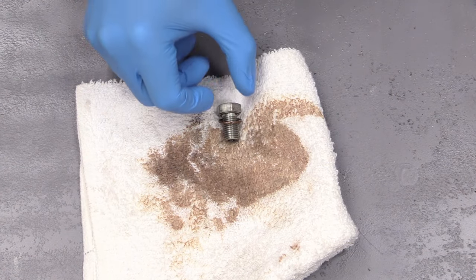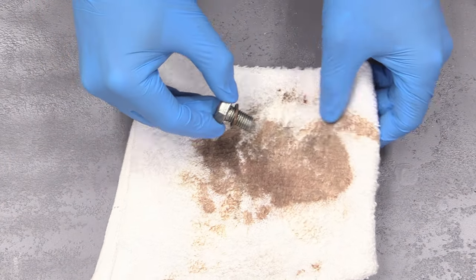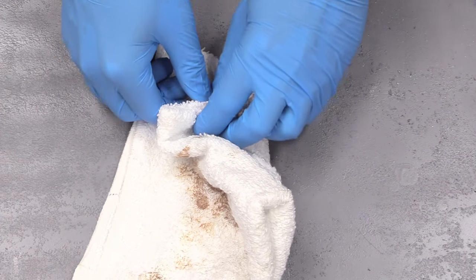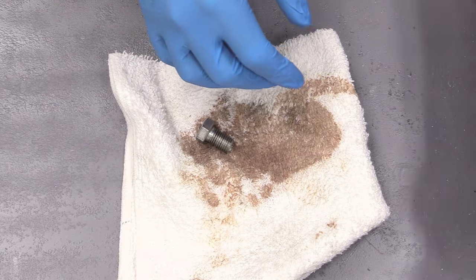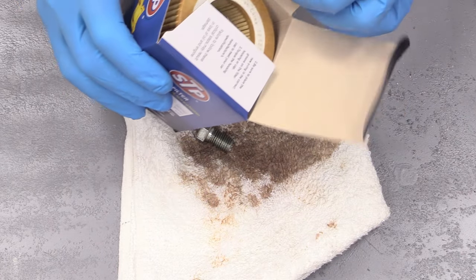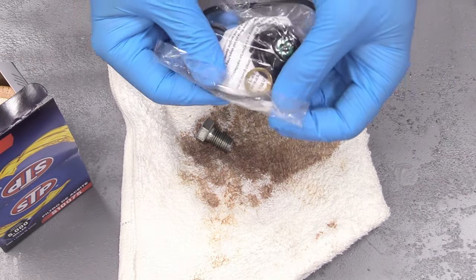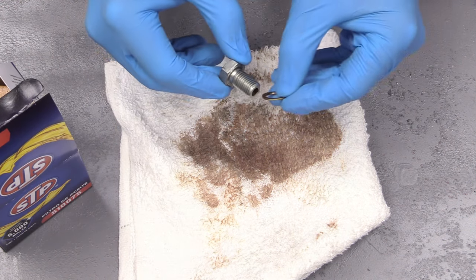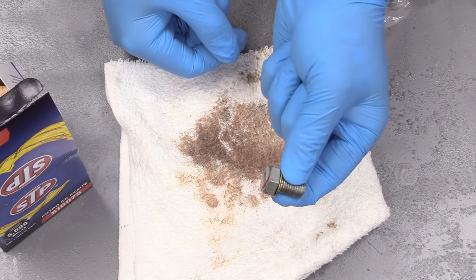Over on my workbench, I have the oil plug drain bolt. Just going to go ahead and clean that off, and then I'm going to remove the copper washer and throw that into the trash because it has been used — we don't want that anymore. I have the oil filter here — link down below in the description. The reason I bring that up now is often on these cars, inside the goodie bag with the oil filter, there's a new copper washer in there. Just don't lose everything else that came with this. We can go ahead and load that up, and now it is ready for the car.